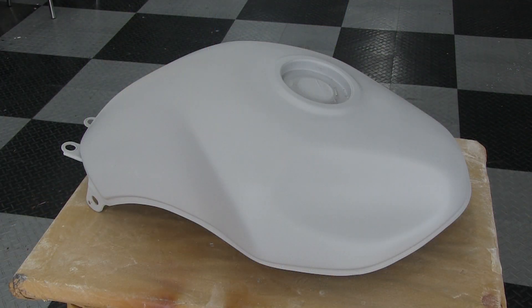With the petrol tank I completely stripped it with an industrial paint stripper — I took it right back to bare metal, wiped it with alcohol, and then primed it. You can't go straight in with a high build primer on bare metal; it's very very important to use an etch or self-etching primer. Leave that for a couple of hours and then spray a 2-pack urethane high build primer over. Ideally you want to leave that for at least a couple of days — the longer the better, but certainly a couple of days.